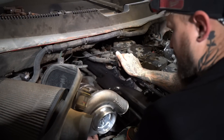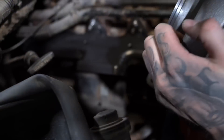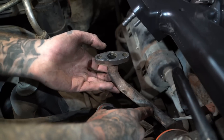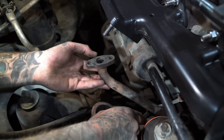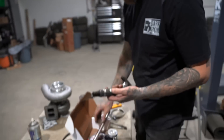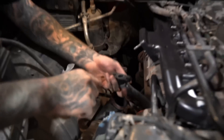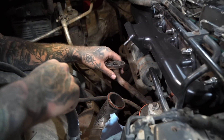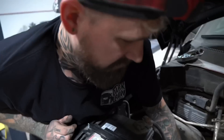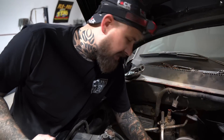That ain't gonna work because of where this is facing — we need to turn it down. The drain line keeps hitting on the turbo on the fresh air housing. I have a couple of options here: a Fleece one and a factory 6.7 Cummins one, but these are a pain to make work and neither is right for the job. We're going to have to modify this drain pipe. The downpipe fitment is to be determined — we have a new downpipe so hopefully that lines up. Right now our only issue is this drain pipe.